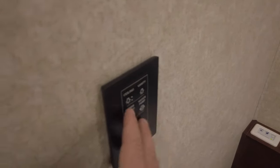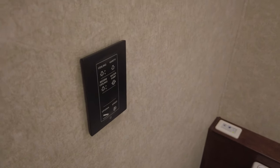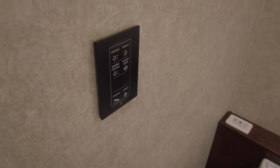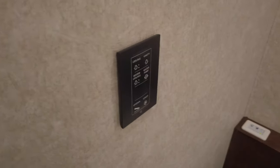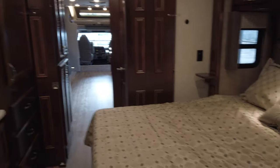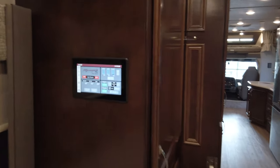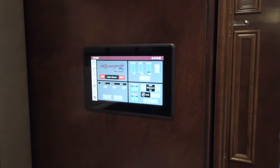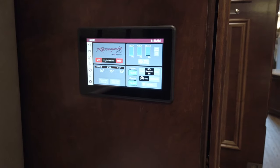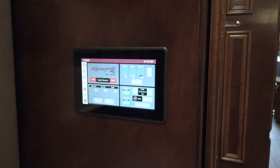As I mentioned, these multiplex switches are wireless — they're not wired to any particular light. If that control panel is not working, some of them are wired with 12 volt from the coach and some may have batteries. So if you're pushing buttons and stuff's not working, the first thing to do is pop it off and make sure you've got a good battery. Nine times out of ten that's the issue, and you'll get a warning light that it's not seeing one of the control panels. Super easy to diagnose, especially as you learn how the systems work.